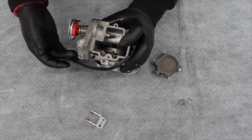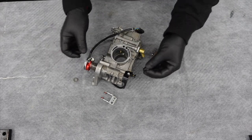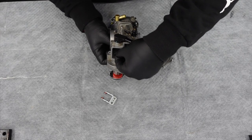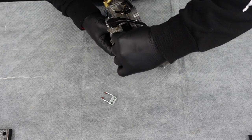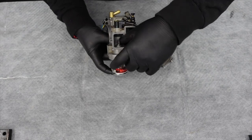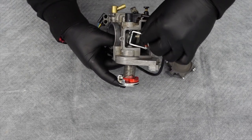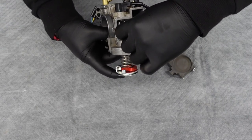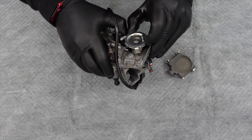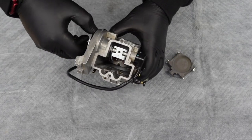So that is what you would do with all the pieces together. Now I'll pull her back out and we'll go back to this step. We need to get our two washers in order — we've got one steel washer and one nylon washer. The steel goes on first, just like that, and then the nylon goes on there, so that if it ever rubs up against our slide arm here, it doesn't actually wear into it or drag on it. We're going to install it like this, a little bit further back, hook it in there — that's all it takes. Then slide it through just a little bit, return over to this side, hold the accelerator pump over, keep rotating right there, and now we have our slide arm installed, just like that.